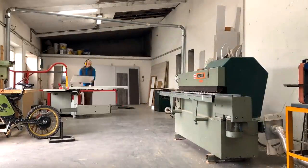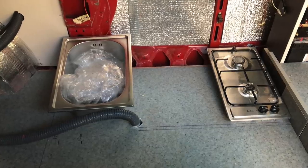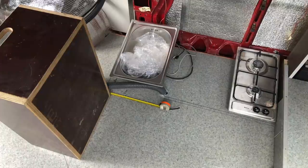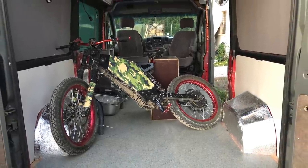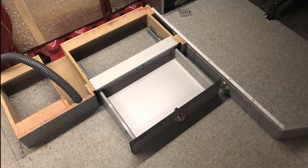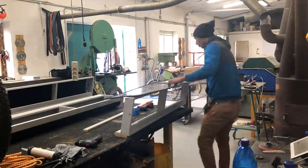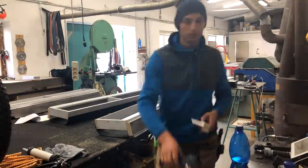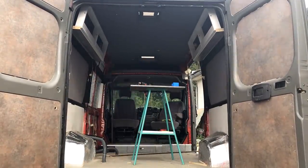For furniture, different people use different materials, but I can easily say the best is lightweight plywood — it's solid, doesn't warp with humidity, and is super lightweight. I didn't have that option financially so I used free 18mm chipboard from my workshop. I loaded the e-bikes in, made sure they fit, and marked their dimensions on the ground, sides, and height on the wall — this determined the kitchen size, electronics compartment, entry unit, and garage unit space. Starting with overhead units, I made the frame as light as possible using thin strips and 3mm plastic sheet bent to shape with black fabric contact-glued on the facing side. Units are attached to the car's structural parts using self-tapping screws.